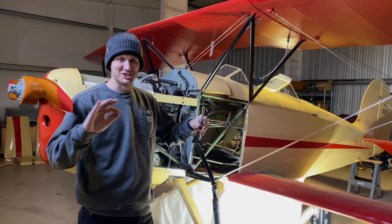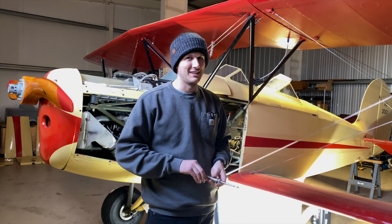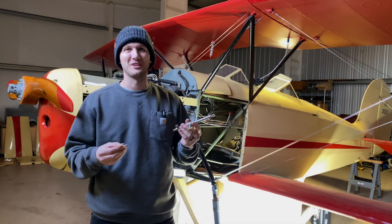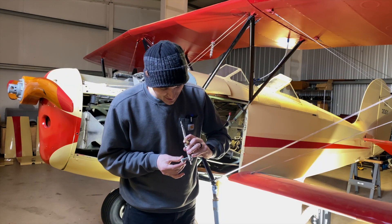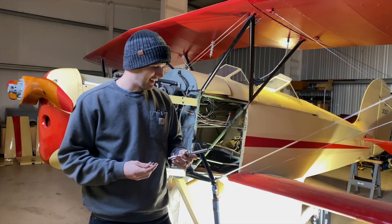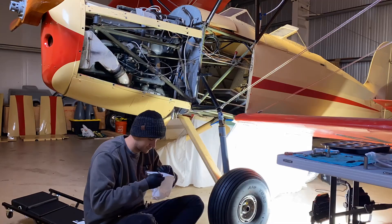Probably one of the biggest changes we're making so far. We have the master cylinders rebuilt, calipers are on, and all new fittings. The tricky part about 90-degree fittings is making the crucial decision of whether to do a full 360 or leave it where it is. We put it in the plane, marked it at a nice angle, and tightened it to that point. We already checked the clearance, had to move the reservoir up a little, and we should be able to get this permanently installed back in the airplane today and possibly bleed it.